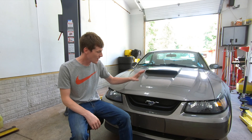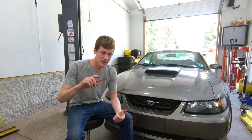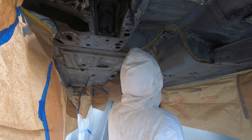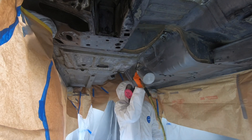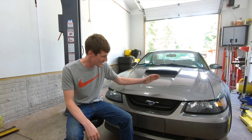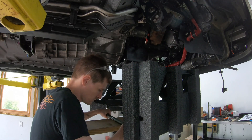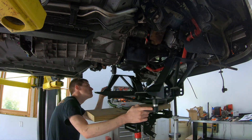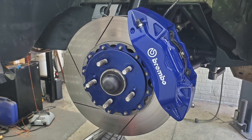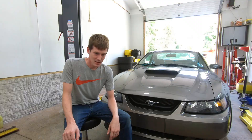Over the past three or four months I've done an absolute ton of work to this Mustang. I started by doing all rust removal from the chassis, then painted it with a bridge primer that'll last 20 years on a salted bridge. I topped the bridge primer with color-matched raptor liner, so the whole bottom of the car has been bedlined to match the exterior. I then installed weld-in subframe connectors, a complete aftermarket suspension from Maximum Motorsport, a $600 big brake kit from a Cadillac ATS on the front, and an oil cooler from Mishimoto.